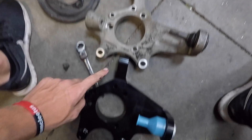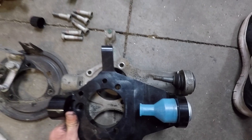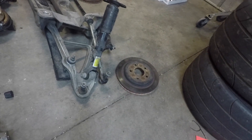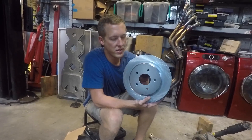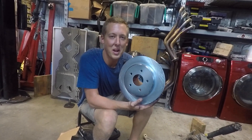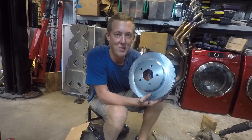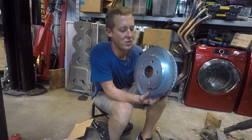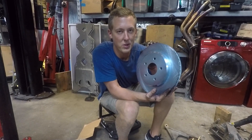This is a factory spindle and this is the Carlisle Racing spindle. You can see overall it's quite a bit shorter, and that's what allows the 15-inch wheel to fit onto the hub. Those are the old rotors — they have seen a couple of second and third gear burnouts, maybe a sixth gear burnout here or there. And these are the new rotors. Glad to have some upgraded brakes. Those were really shot, pretty jacked up. With the new Carlisle Racing calipers and pads and everything, it should make Leroy stop a little bit better.